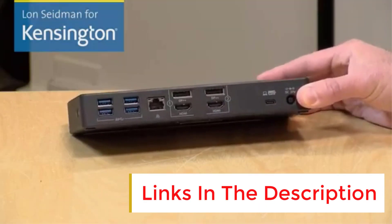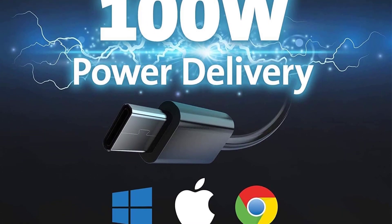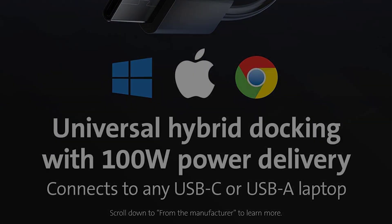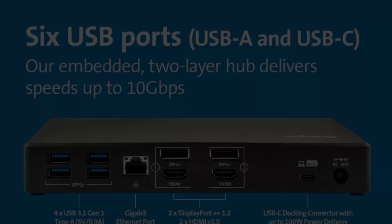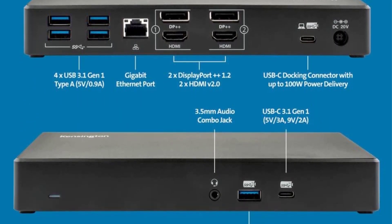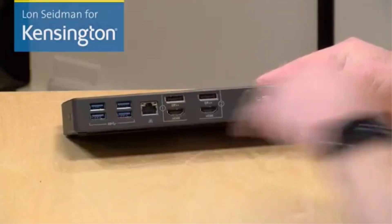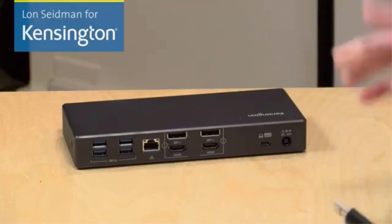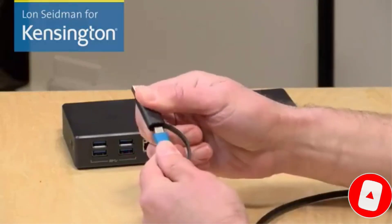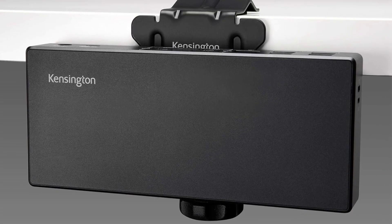Number four: Kensington SD4780P Thunderbolt Docking Station. The Kensington SD4780P Dual 4K typically requires a DisplayLink driver, but any Chromebook made after 2017 supports the connection from the start. Finding a docking station that works with Chrome OS is tough — of the 12 units I tested, only four connected at all with the Asus Chromebook Spin 514, and one of those four couldn't run two monitors. The SD4780P uses a USB-C host connection through which it offers a maximum power delivery of 100 watts, and was able to run both the 4K and HD screens cleanly. It allows for a wide range of USB-A peripherals through five such ports, but there's only a single downstream USB-C.